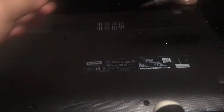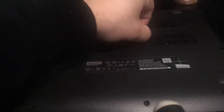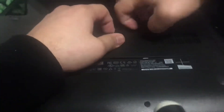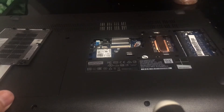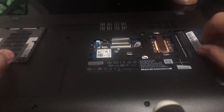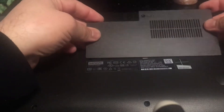There's 4GB RAM soldered onto the motherboard and there's one RAM bank empty — that's the empty slot. You can add another 4GB or 8GB module, or potentially go up to a 16GB module. For a 16GB single slot, you may need to update the BIOS firmware.